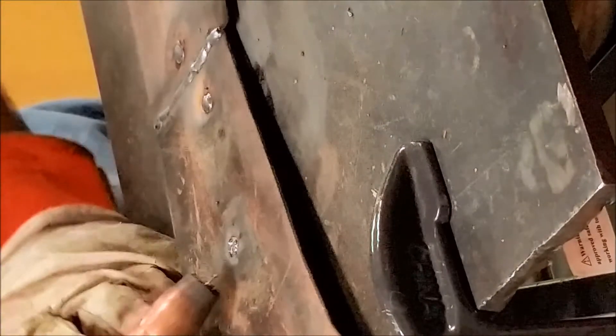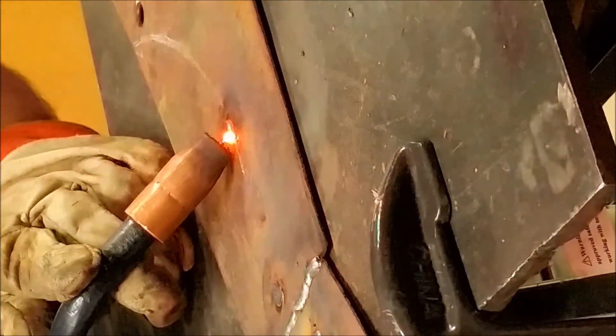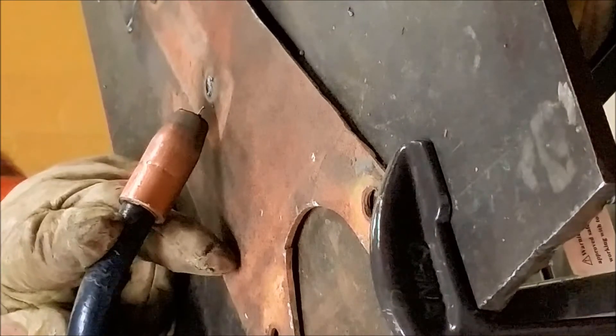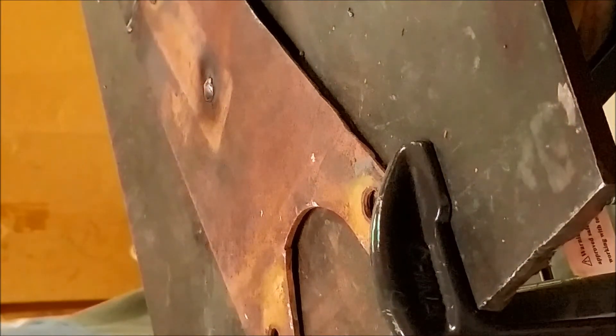You can see there's a little crater — I'll just fill that in and move to the last hole. You can use this technique when working on cars and sheet metal especially. Just remember: when it gets bright red, let off, then press the trigger again and you won't blow holes. Really good technique to practice. Now I'm going to grind these down and cut it.